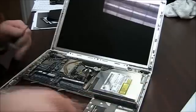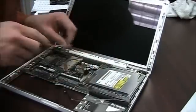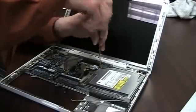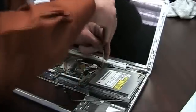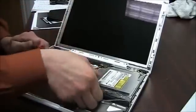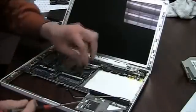There are typically two screws right here and right here that you have to pull out in order to pop this off. On the back side near the speaker there's a screw, and on the inside you'll have another screw that's kind of hidden. Just unscrew it, and if you can't get it out, pull the SuperDrive and there's a little screw there — it just plugs in and is a little hard to get in but you can do it.